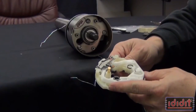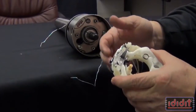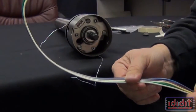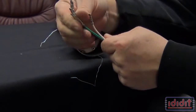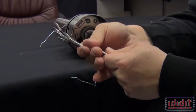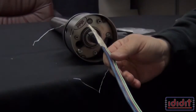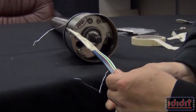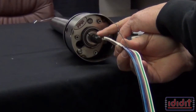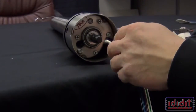Now we're going to prep the new harness to go into the column. When it comes to you it will be in a circular pattern. What we would like to do is take the wires and bend them flat, then tape these flat as well. String them out so that you can make them flat without too much hassle going through the column. Now we can take these wire ends and put the tape on like we did in the previous stage. Then put the pull wire and hook it through the harness with the black wire of the harness facing towards the center shaft, so that the harness comes up and out the column in the correct manner. Tape that to it.